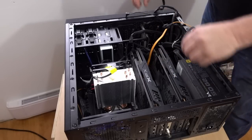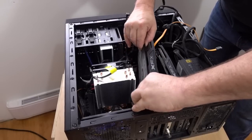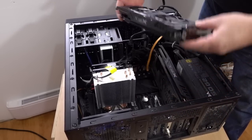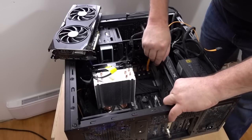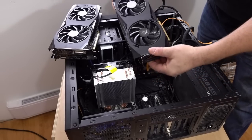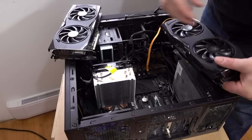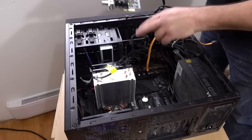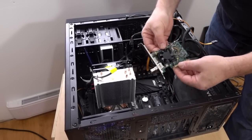The first things I'm trying to get out are these two graphics cards — they just pop out like that. These are RX 480s, and these are the problem inside this case because they get pretty hot when rendering a video. There's not a whole lot of airflow — you can see how close this one was to the power supply, those fans could barely operate, and this one was partially blocked by this smaller card, which is the DeckLink card. That drives my second monitor full screen.